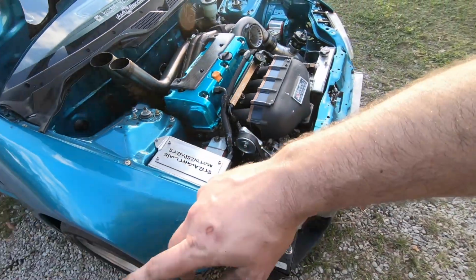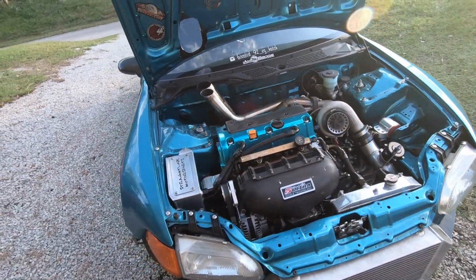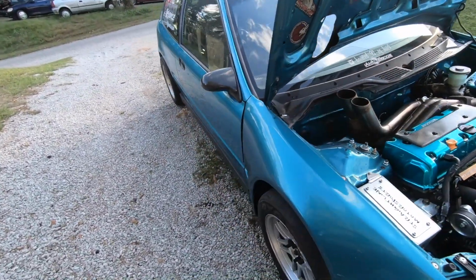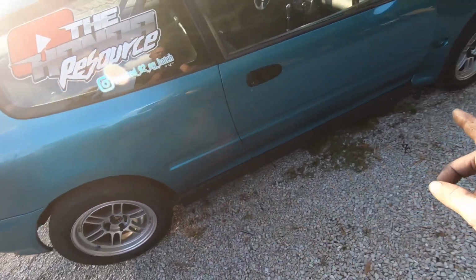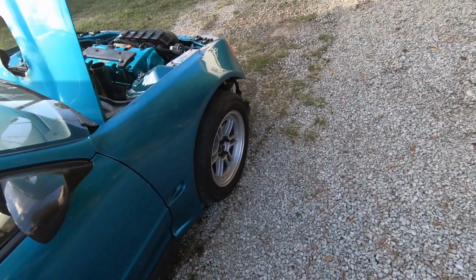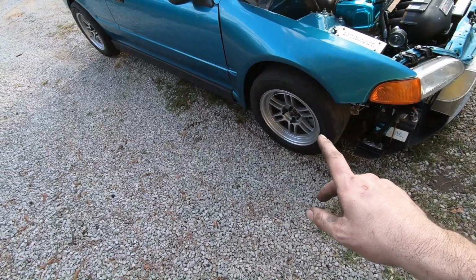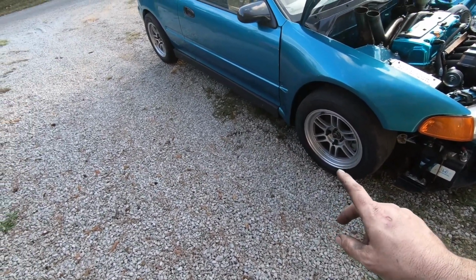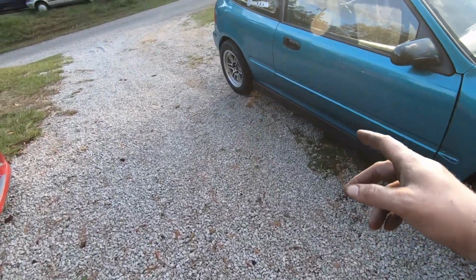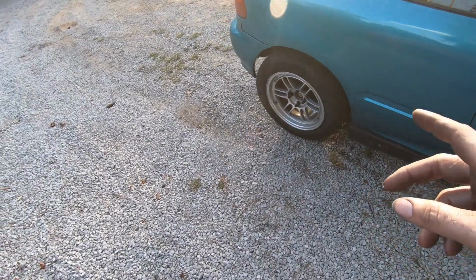I think I've already mentioned it has the Drive Shaft Shop 5.9s on the front. Got the Insane Shaft in the rear. It's got a Land Rover Freelander driveshaft. It's got a CRV diff pinned, and it will not come with RPF ones. I'm going to put it with the drag wheels, so it'll have 4 slicks. The front slicks are on Weld wheels. They're 13 by 10 wheels on 24.5 inch slick by 9, and those are Mickey Thompsons. And then the rear is a 15 inch VMS wheel with 24.5 by 8.